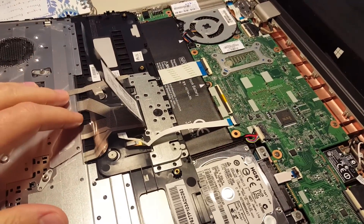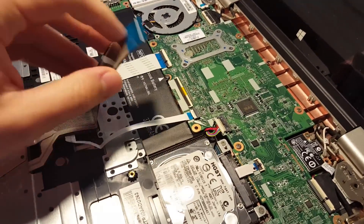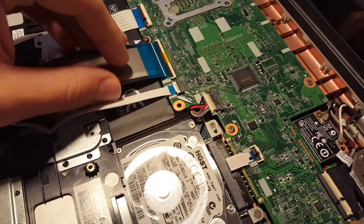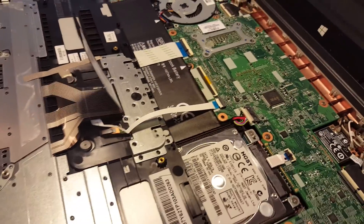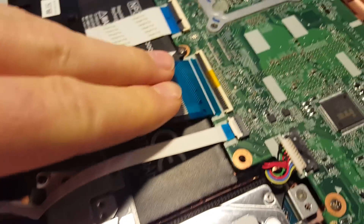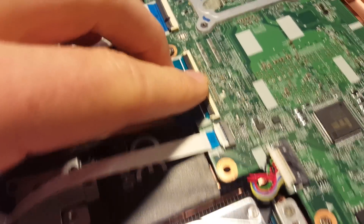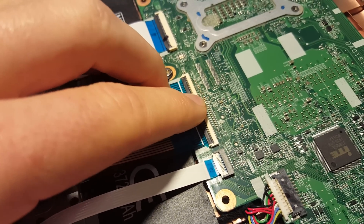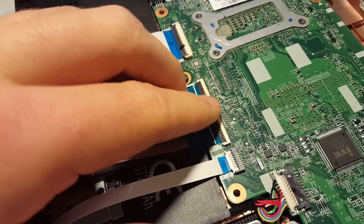The reason the keyboard is not functioning is that this ribbon cable here is not inserting correctly into this locking clip connector. What's happening is when I put it in and press down, you can see it's not really locking — it's not snapping into place. It just kind of moves up and down no matter what I do.